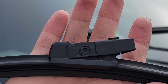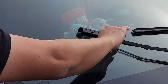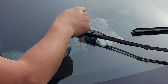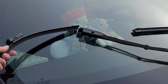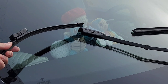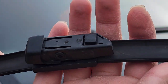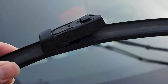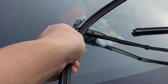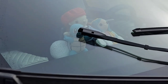Here you can see what the wiper blade mechanism looks like. You do want to set it down gently — you don't want to drop it onto your windshield and damage the wiper or the windshield. That piece is plastic, so if it breaks and then slams into the windshield, that could be bad. That's what the mechanism looks like, and it wobbles around like that. Very simple, easy to do. 26-inch blade on the driver side, 20-inch blade for this one.